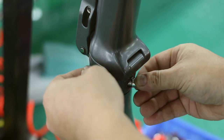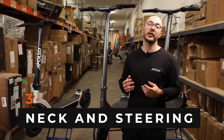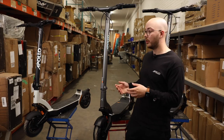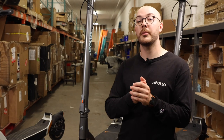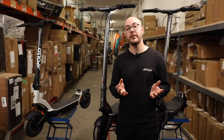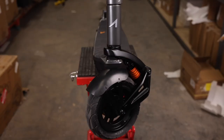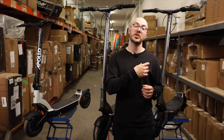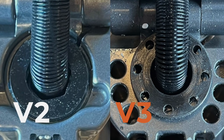When we were riding the first prototype, the steering felt completely fine. However, on the V2 we noticed that there was some resistance when turning the steering, and also it was becoming loose and it was impossible to tighten it just with the folding mechanism. On the V3, we upgraded the grade of the bearing to ensure that it's always going to be butter smooth, and also we changed the main direction screw to allow a spanner wrench to tighten it if it ever becomes loose.